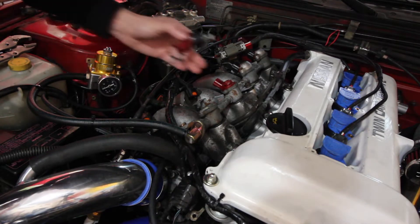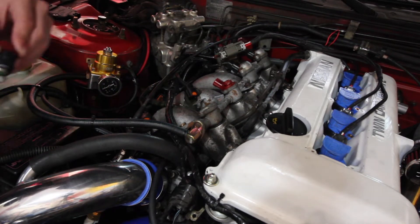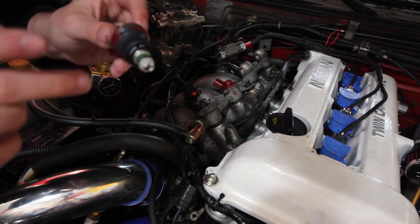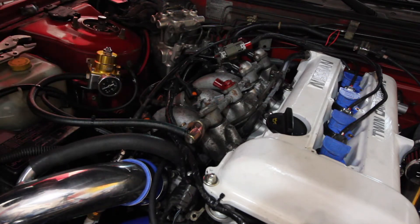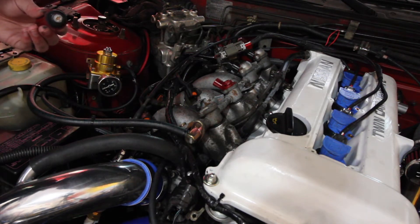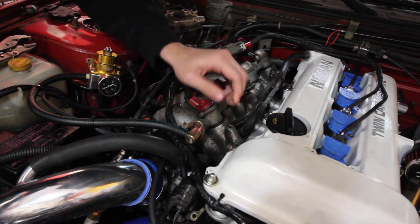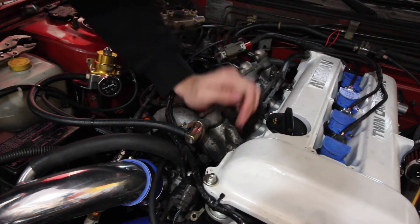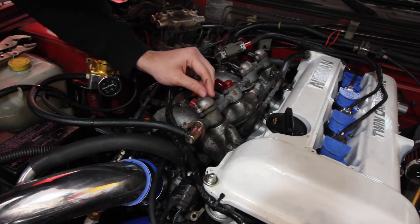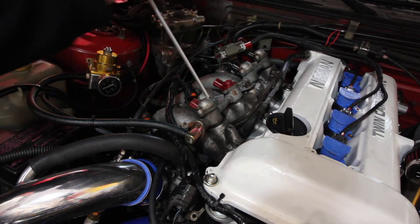I forgot to hit record but I put the possibly dead injector right here, and this is the one that came out of cylinder two. You want to make sure you lube the injector up really well because if you don't it's not going to slide into place properly. You also want to lube the lower o-ring. When you're putting the injector in, you just put it in the correct orientation and push it in by hand - it should click into place nicely. Then we're going to throw these caps back on because I believe they act as a ground.